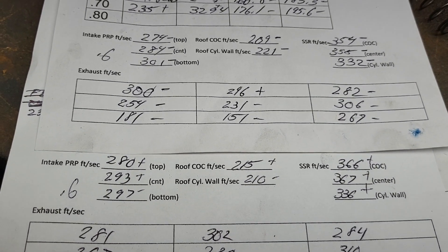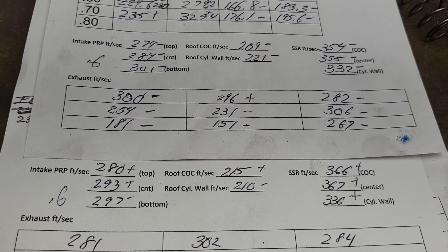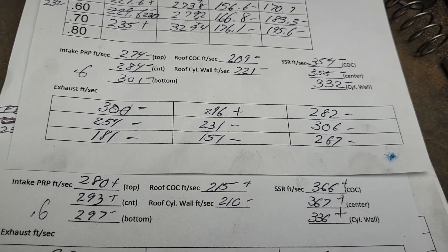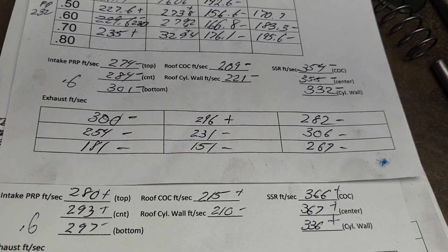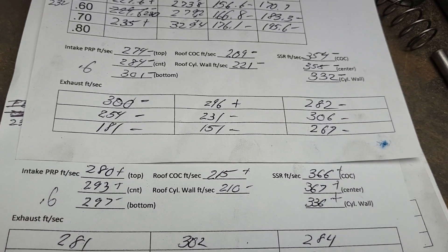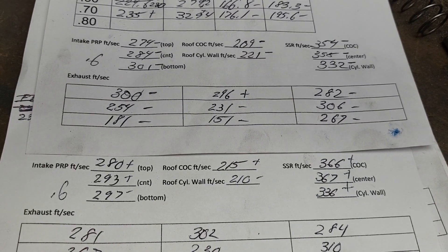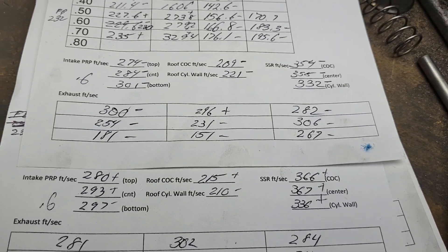But let's face it, most of the valve breakage we'll ever see is due more to poor guides and valve float than anything else. Because how are you going to keep valve train dynamics if your valve is flopping all over the place? I've seen it a lot where the guides start to go and the guy doesn't care, keeps racing it, everything's slopping around, and then something just grenades the engine.